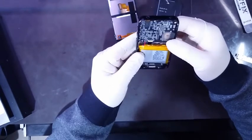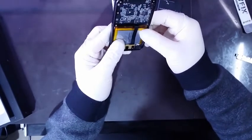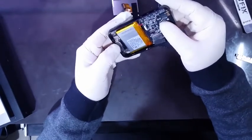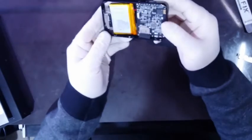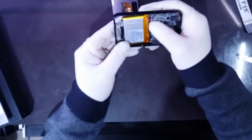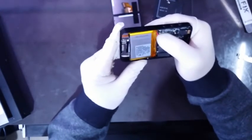Other than that, here it is, the PCB. Looks very simple. There's a ground connector with the screen. This is for guiding the antenna connector, LCD, the USB connector, and that's it. Very simple. The PCB is screwed to the frame. The USB connector is also screwed to the frame. I guess other than that, good detail. I think they add some conformal coating on the connectors in case there is some water or something here. It will prevent short circuit. But yeah, other than that, very simple.